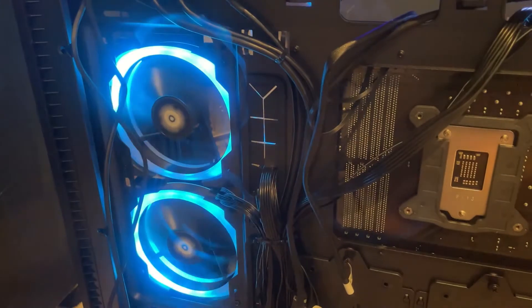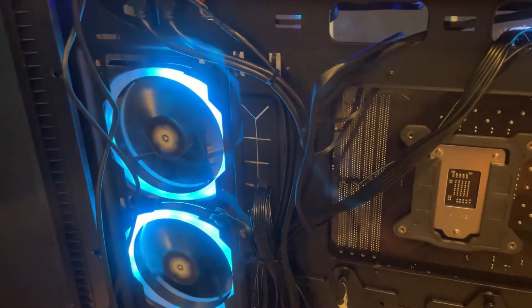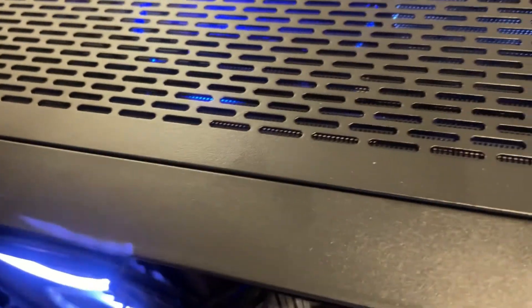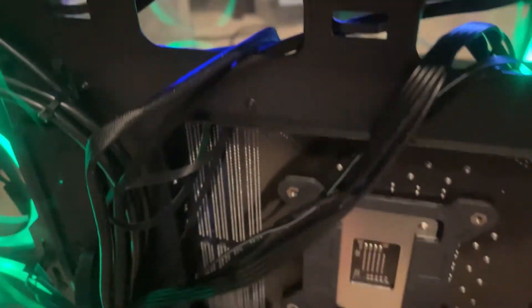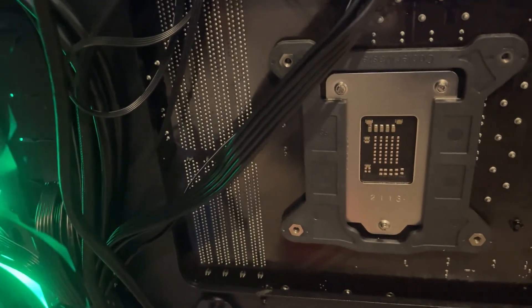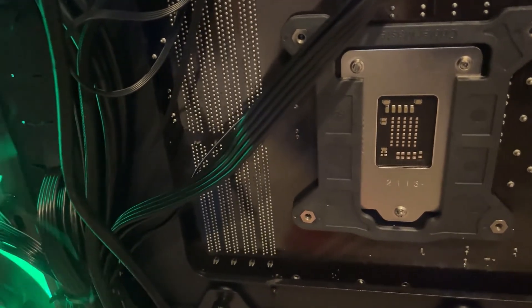On this CyberPower machine I flipped the two side fans like most people say in the forums, and I added two large 120mm fans on top as exhaust. Still I'm getting those high temperature readings. So the only solution is to replace the cooler on this CPU, and that's what I'm probably going to want to do.